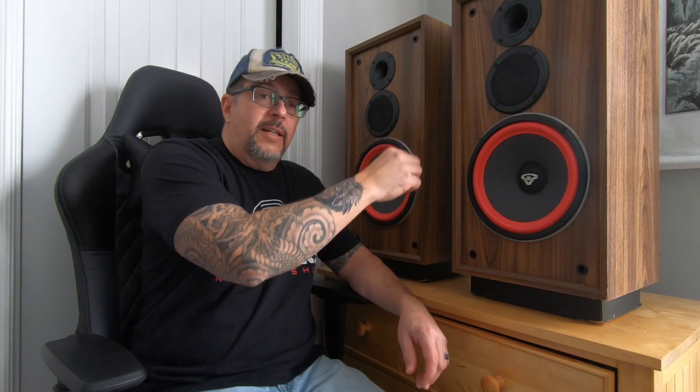How did we end up at this point with finished speakers? Long story short, I had a big mess on my hands — adhesive and foam all over the place. Then I started adding rubbing alcohol into the mix to get everything cleaned off, and it was just gooey crap everywhere. So my advice to you is if you're going to do the re-foaming, make sure to clean up after you remove all the foam and adhesive. Then you can start doing the alcohol cleanup, then do your glue. Other than that little issue, it was pretty smooth doing the re-foaming on it. I think it turned out pretty good. I planned on flipping these speakers too, but I was so happy with them after re-foaming and just listening to them that I'm not getting rid of them now.